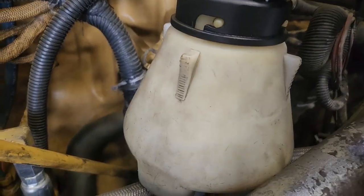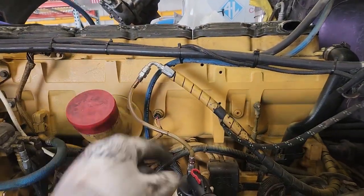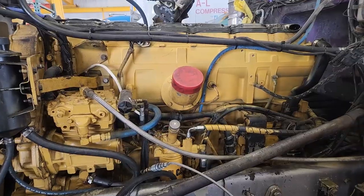You can see that's like a second coat of paint there. What I'm doing here is pulling the air out of the fuel system. I just put a brake bleeder on the return line of the head because the head's the highest point in the fuel system — very hard to get air out of that. That's why I prime it that way.